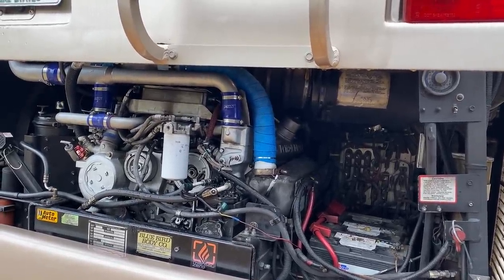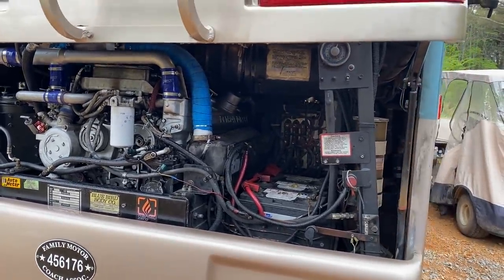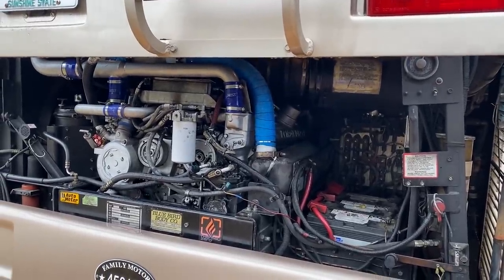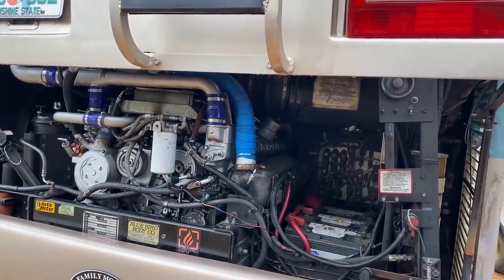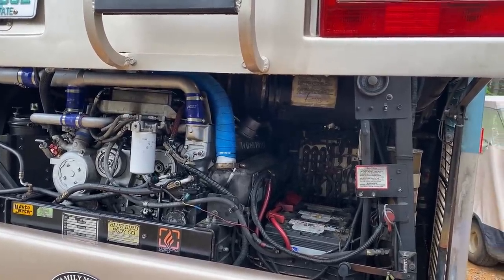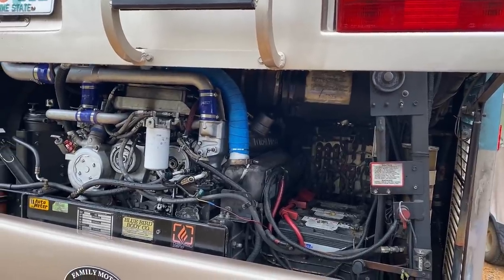We're gonna fire it up here this morning, air the bus up, get the blocks out from under it, and then immediately take it out on the road for a test drive. Get it under a load for a while. That's really good for the rings to get it run in under a load. No leaks at all that we've detected so far, which is really good, but 5 minutes of idle time isn't really a very good leak detector. So as soon as we get a few miles down the road, we'll pull over and check it out, and we're gonna hope that we're pretty leak free.